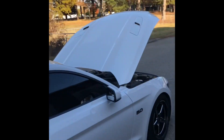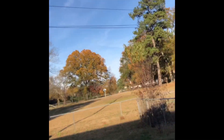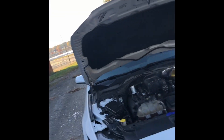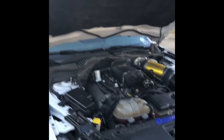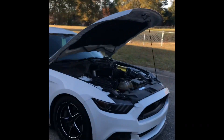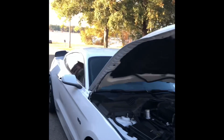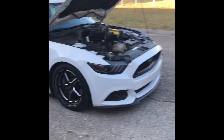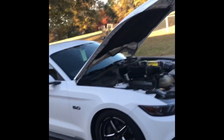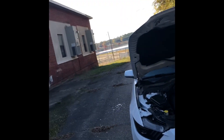If I do keep the car I'm most likely going to go Turbo 400 in it. If you don't know what that is, it's an older Chevrolet three-speed automatic transmission. Automatics will always be faster — it's just a matter of what you want. Personally I believe a manual will always be more fun if you know what you're doing, but if you want to win races you have to go automatic. It's more consistent, easier, and most likely going to break less stuff.